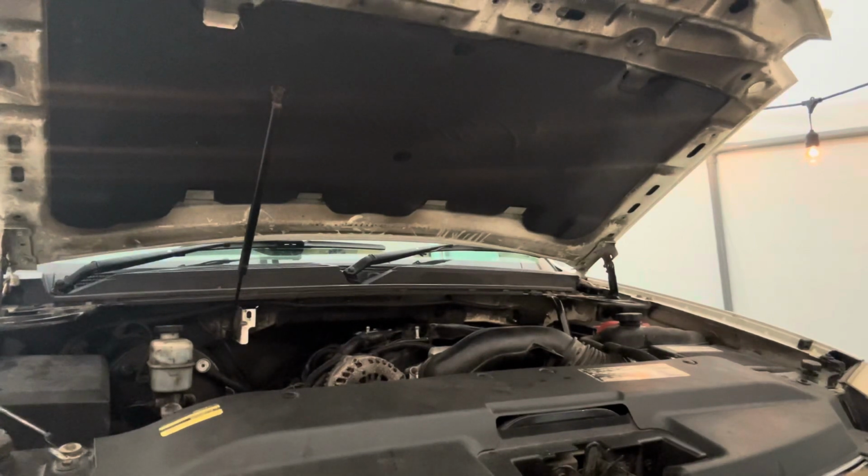Oil gauge is reading 63 PSI oil pressure. It's got fresh oil. It's got a fresh oil filter. I put the relief valve in the pan, so if there's any needed relief there, then it'll be there. So it's firing on all cylinders.